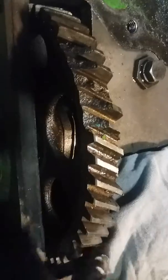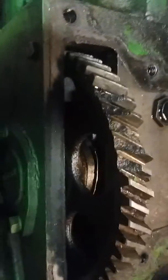And there's 3 other spots on this. This is the cam gear. There's 3 other spots where teeth are chewed away, so I gotta pull out the cam, which means I gotta take the clutch off, which I got half of that done. There's the clutch assembly. But in order to pull the pulley wheel off, I have to remove the tire and wheel because I need like 1 more inch to slide off of the shaft there for the clearance. And I also took the brake off of this side already. This whole housing has to go.